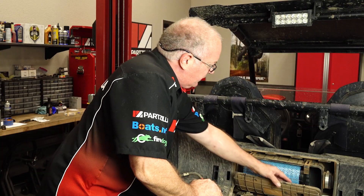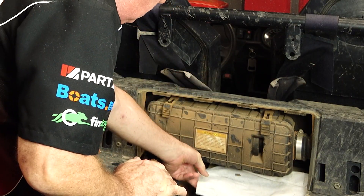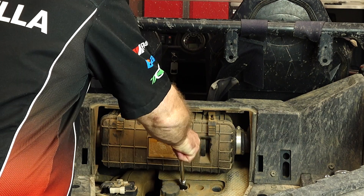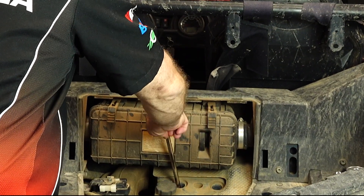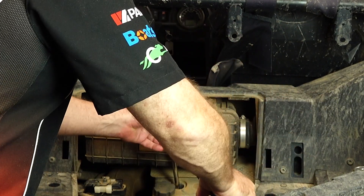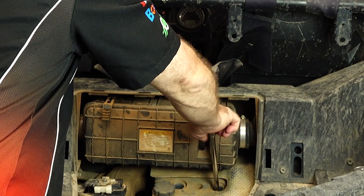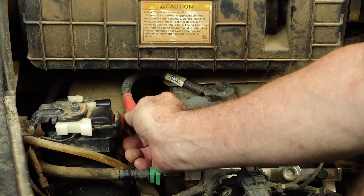Just make sure you push that all the way on so this back section will grab it and hold it in place. Now we're going to pop these plugs in, and there's a great debate on this — do you use anti-seize or not? For the most part, I do, especially on anything in the marine environment: jet skis, marine engines, all of it. There are arguments that if you use anti-seize it lets it over-torque, but this one's not going to be in a salty environment so I'm not too worried. We're going to torque them to seven foot-pounds. I give this about a 40% chance of fixing the problem.